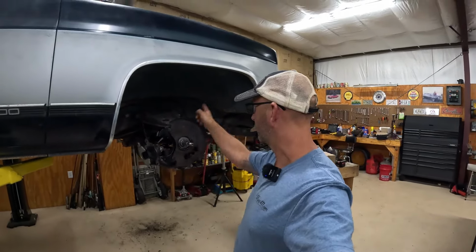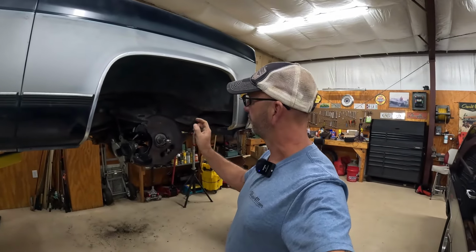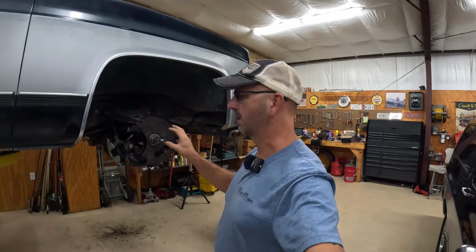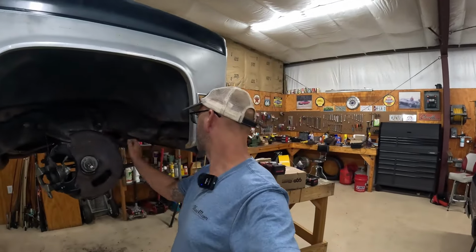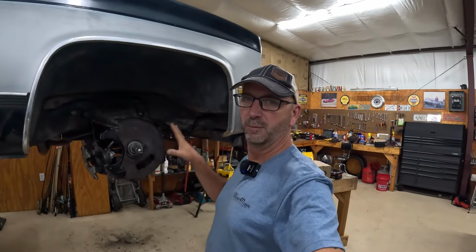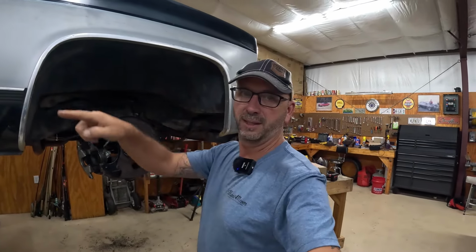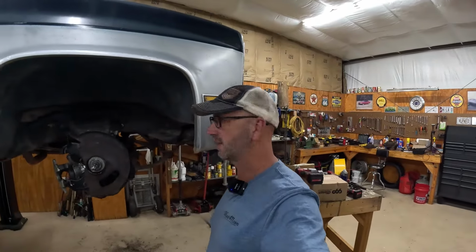So we got to make sure we got our cotter pins in on the other side. What else do we got to do? Cotter pins, the hub back on, make sure that gets all greased up well. Yeah, sway bar. So we got a few odds and ends. We'll finish this front end up, put the wheels and tires on the front, and then we'll jump over to the flip kit. We'll tighten the rest of these little odds and ends and we'll hop into the back.